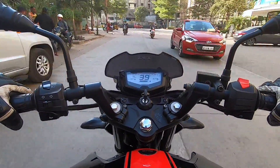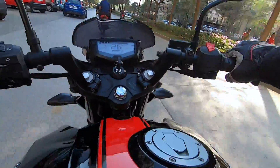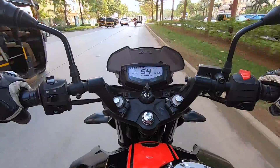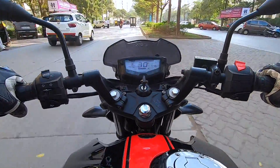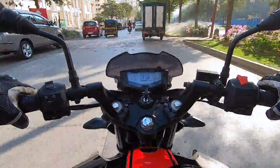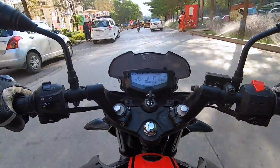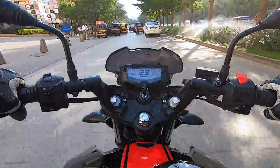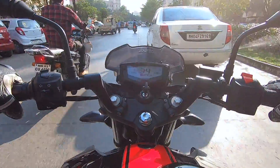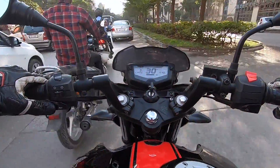The biggest mechanical change in this variant is the ART slipper clutch — ART stands for Anti Reverse Torque. This slipper clutch gives you a big benefit when you are riding fast in the city or on a fast highway tour and you downshift — dropping one or two gears during emergency situations or when attacking corners. Your rear wheel will not lock or hop. The clutch slips a little to maintain optimum revs and rear wheel speed, so your wheel doesn't lock and you can continue confidently without any nervousness.